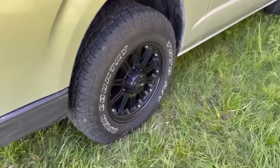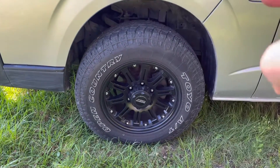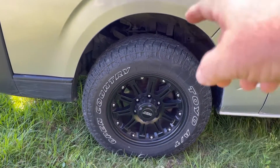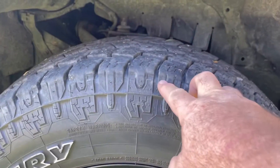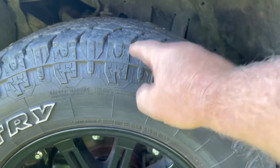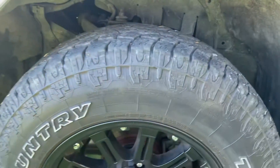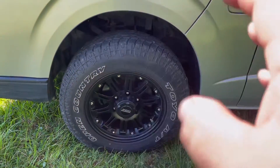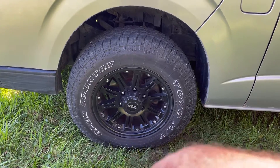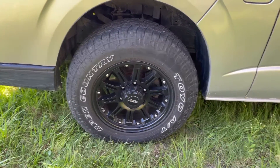Now with tires — all-terrain tires, even though the 225/70 series will be taller, they measure it from the center of the tread. The actual tire height is measured to the top of the tread, not the casing. All-terrain tires have chunkier tread, so the overall diameter will be bigger. The chunkier you go — from AT to MT (mud terrain) — the taller the overall diameter.